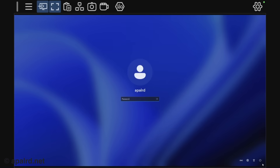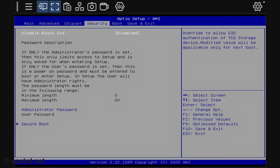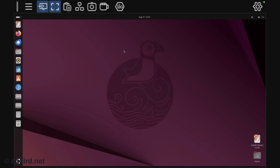So I have a Mac keyboard, so I've got to hold function and press delete, which takes more than one hand. I needed the escape key instead of the delete key, but now I'm in the BIOS. It looks like I can navigate the BIOS just fine. We're going to boot up to the UEFI disk as a boot override — and we're into Ubuntu just as expected, and the KVM works just as well.